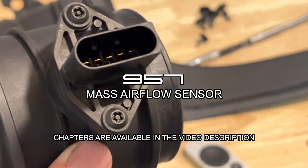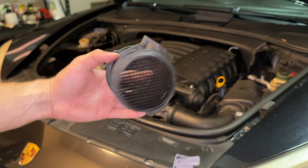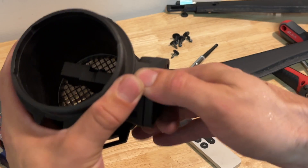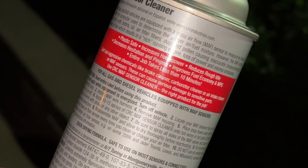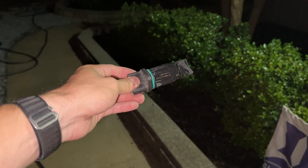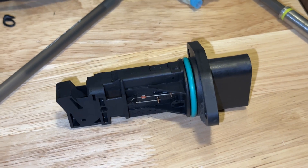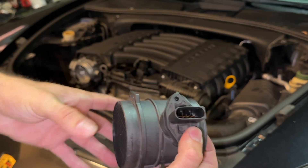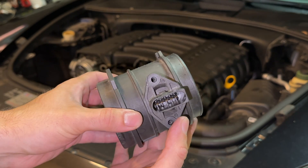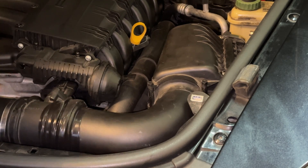The right air-to-fuel ratio enables fuel to burn at maximum efficiency. Keeping the mass airflow sensor clean, as it measures airflow, improves this air-to-fuel ratio, helping your engine measure airflow more accurately and delivering improved performance. When the MAF sensor is not clean, it can cause improper air-fuel ratios, causing misfires, as I experienced firsthand on the Boxster. Cleaning the MAF sensor can clear misfires and other headaches, and is a good first step if you have misfires or just want to improve efficiency.